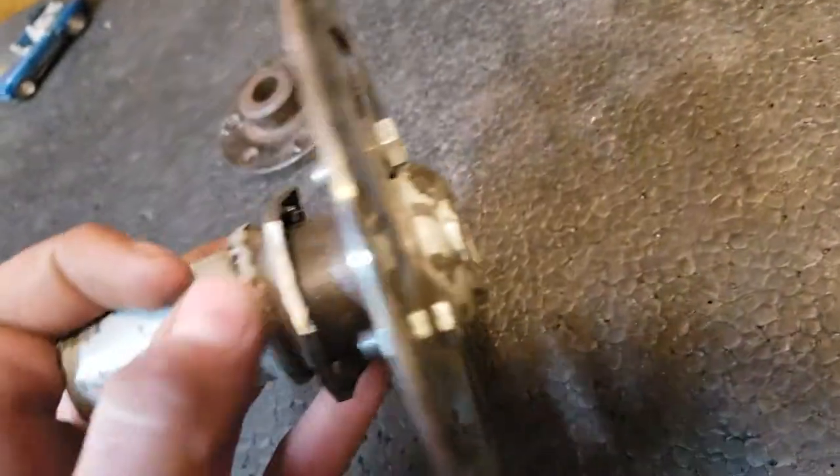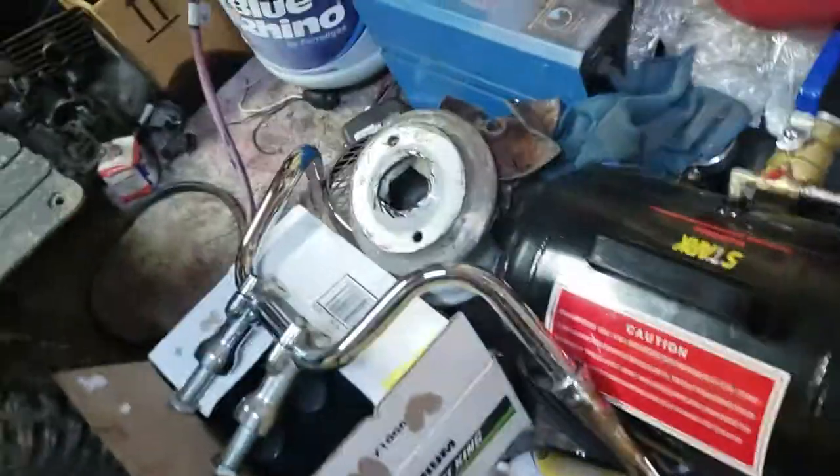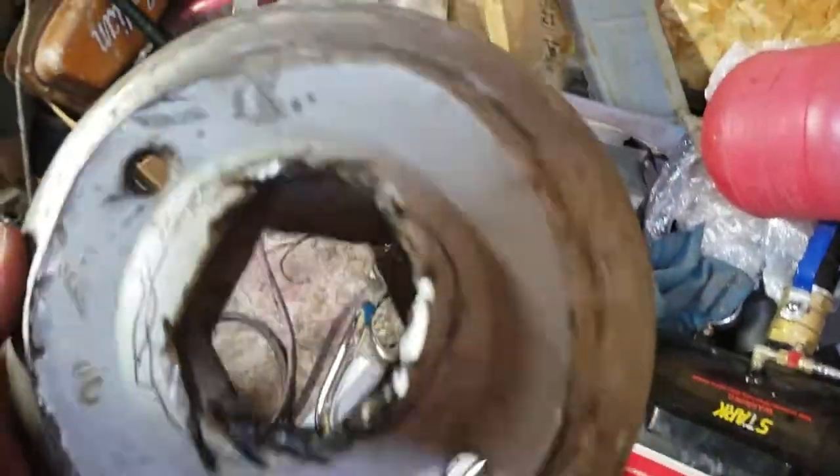Then you can mount the caliper wherever you want, load it up, drill some holes, and hold it there. Now the other way — which is the way we'll be going here — is the live axle setup. You've got live axles like this on your lawnmower, or you can even take these spacers out possibly on your star transmission. You can easily just sit that, pull it up in there. The way I made this adapter is: this is the center hub out of a rim. You can see where the two pieces are sandwiched together right there — this is the other pretty big piece of it.